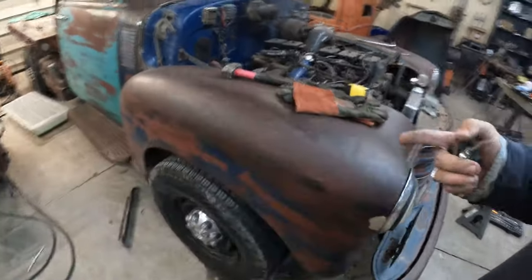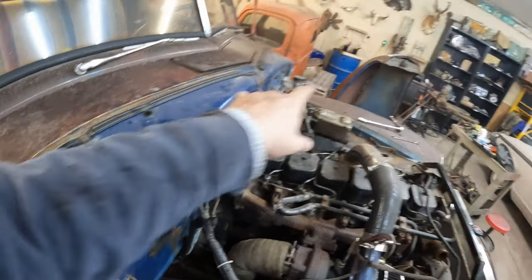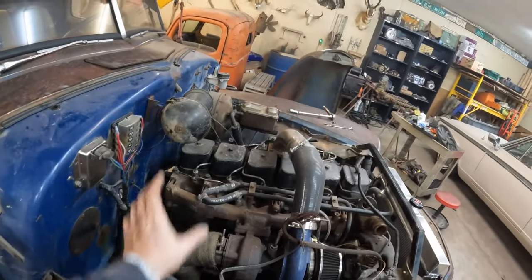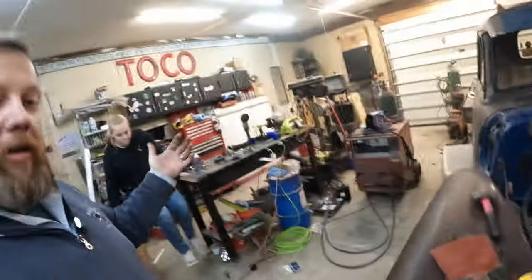I said the other day I needed 37 inches total, but that was from here to the center of the grommet. I'm actually 6 inches out from there, at the hoop that comes under the hood here. So I'm 31 inches total length. So that's the plan.